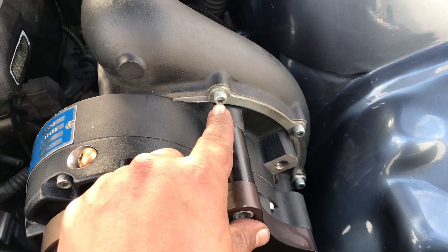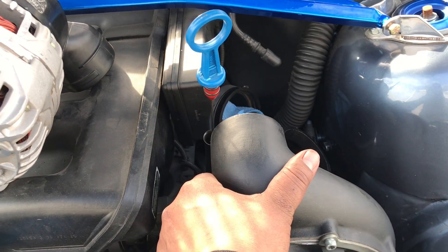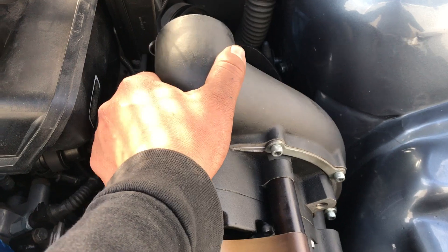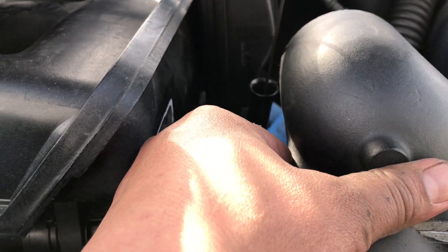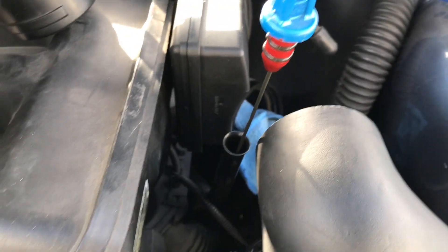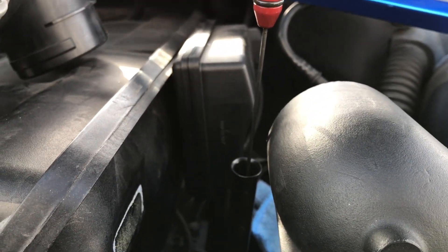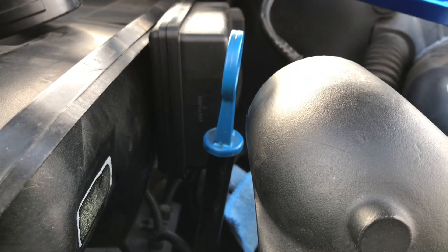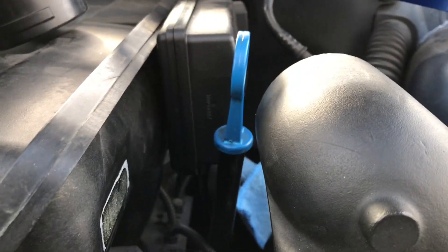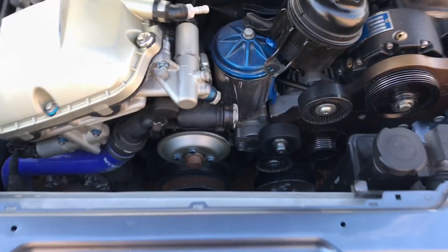As you saw last time, I loosened up all these bolts so right now they're a bit loose, and it's just a matter of turning it - the supercharger will turn back and forth. You want to make sure you get clearance, so I'm going to set it about there - maybe right there - that should give me plenty of clearance. We'll lock it down. The dipstick we may have to modify, just bend it a little bit to the left to clear it better.